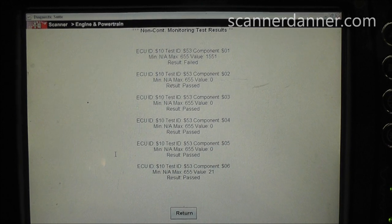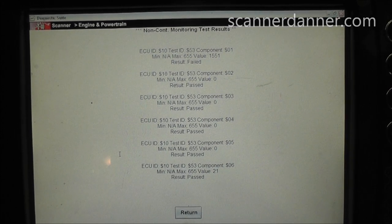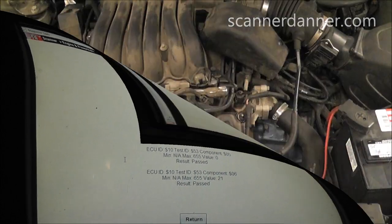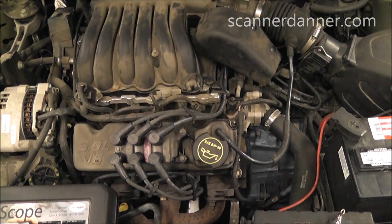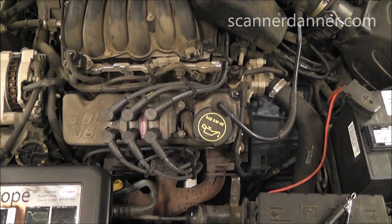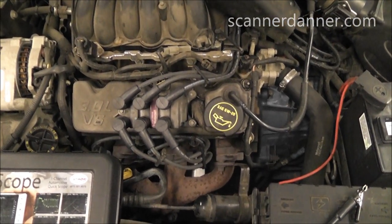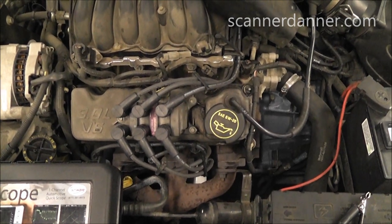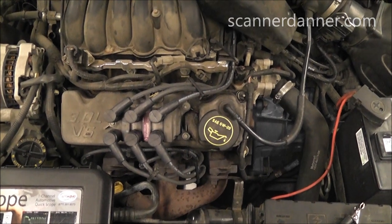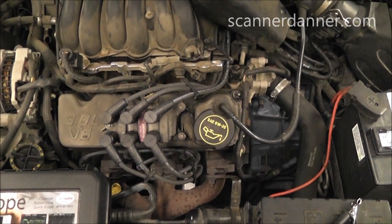The history of the vehicle is that it just had plugs and wires put on it, and the misfire is not felt all the time — pretty much under load is when it starts to misfire. The direction I'm picking for this Ford is to attack the ignition system first, and the reason is simply that these coils are known for failure. I've shown in another video a cylinder drop test where you can have one half of the coil not firing. So I'm going after ignition again, even though plugs and wires were just replaced.